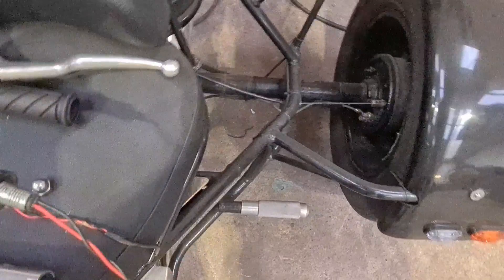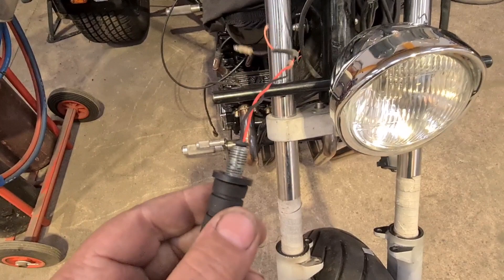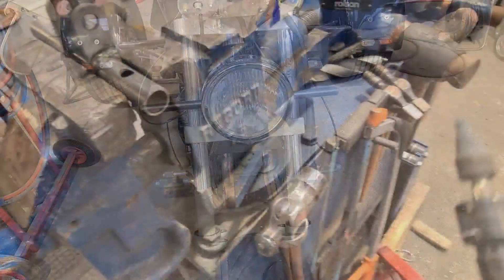The indicators sit on the ends of this bar. They fit like that and it's too wide for the new front end, so I'm going to shorten it by 3 inches. If these threads are something I've got a tap for, I'm going to make some new threaded inserts, chop this back, weld them in - bit of lathe work, bit of cutting, bit of welding.